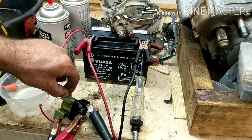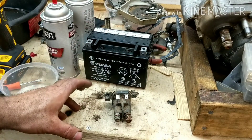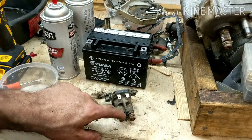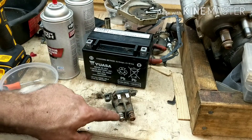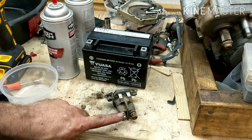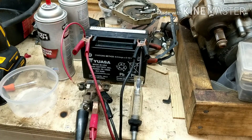If you're not getting power to the other side, it's a bad solenoid — order a new one up. You can do it on the mower itself as well. This is the line going to the starter. Just put your test light here, put it on your ground somewhere, put the test light right here, turn the key until it clicks, and make sure you're getting power going to your starter side of the solenoid.